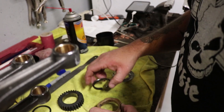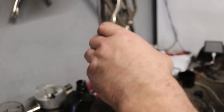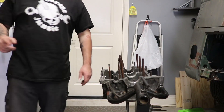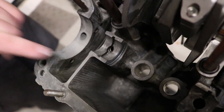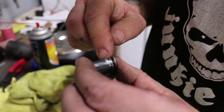This is the spacer that goes in between the gears. The cam bearings — thrust bearings in particular — have a tang on both bearings. However, the case does not have a tang on both sides of the case. So you have to file down the tang on one of your thrust bearings. Which I think is silly — why don't they just make it without it? But whatever.